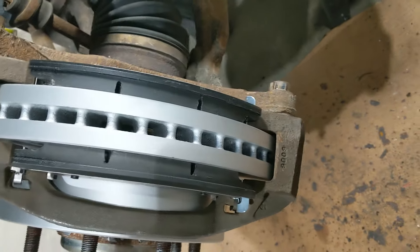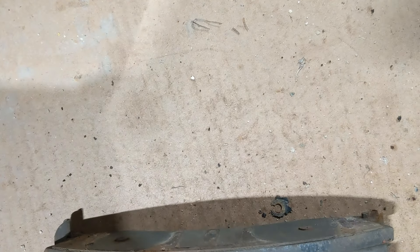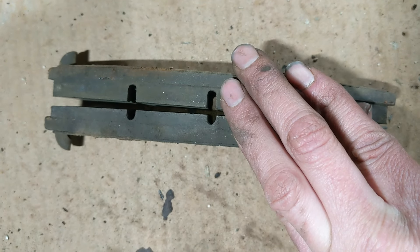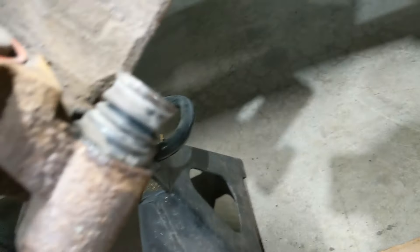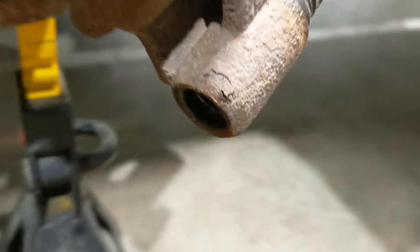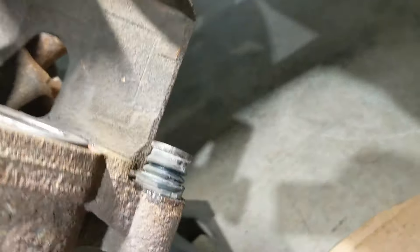This truck was pulsating when stopping and the pads were wearing unevenly — the rotors were warped and the pads had uneven wear. The outboard pad was about double the thickness of the inboard. That happens because your caliper can't move on the slide pin — it gets hung up and only applies pressure on the inboard pad. To fix that, pull the boots off, and on this truck the lower bore had a bunch of corrosion inside. Ream it out with a wire brush and clean it out well with brake cleaner or lacquer thinner.